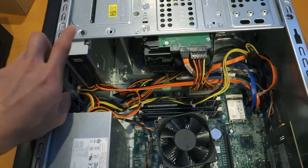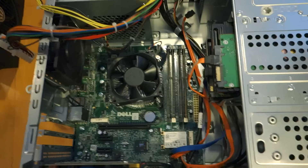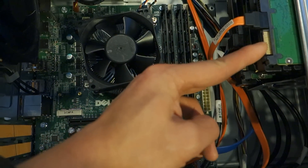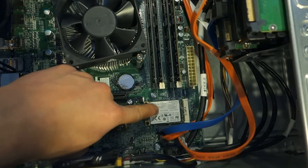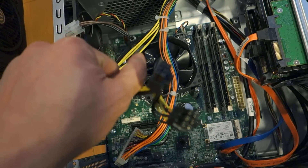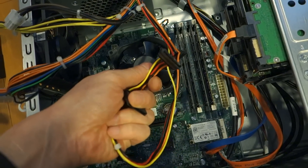I'm disconnecting cables from the optical drive, my two hard drives, and the mSATA drive down there, as well as the main board and various other components. To recap: it was one 12-volt 4-pin, the main 24-pin, and two power attachments for the hard drives. I don't actually have a separate SSD since it's on my mSATA drive - I can boot into Windows 8.1 literally in seconds. So those are all the connectors: 24-pin, the one for the R9 270, the 4-pin 12-volt, and the hard drive power pins.